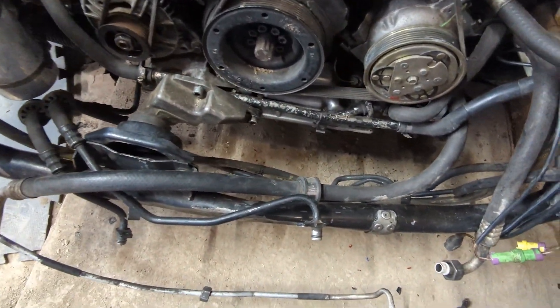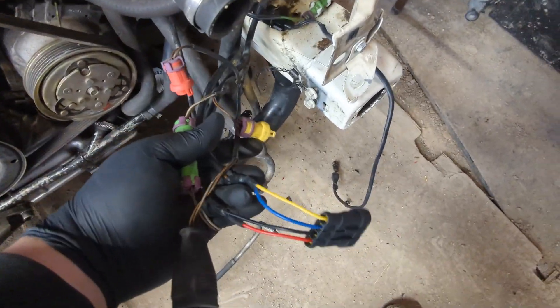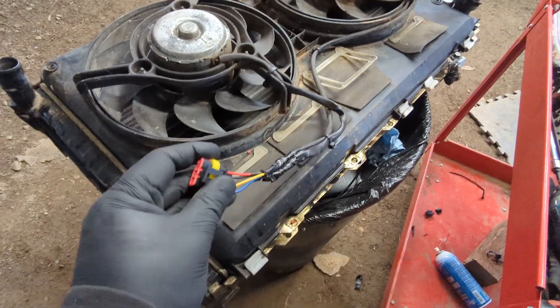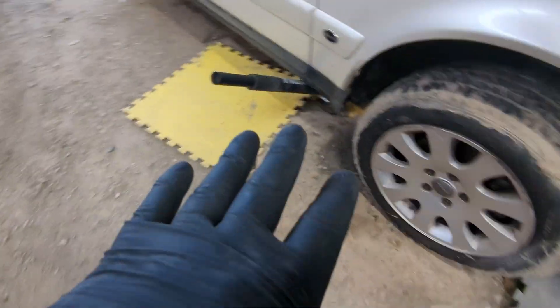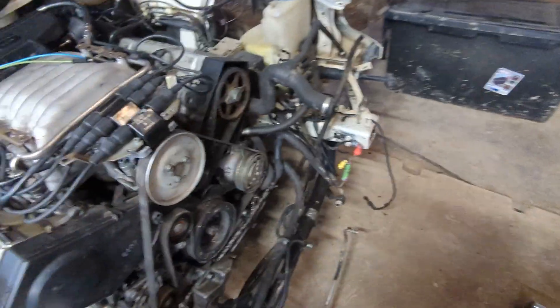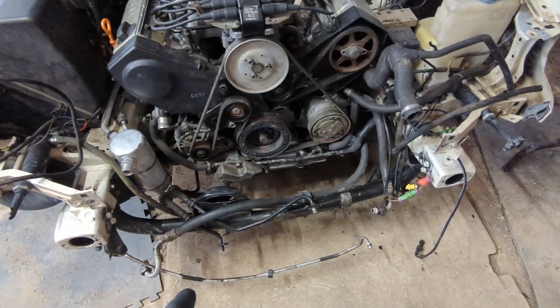I fixed some wiring harnesses. The fan harnesses were busted, so I soldered them up and put on a 410 connector over here as well. Soldered and heat shrink, I just put tape on for extra strength and then fixed that up. Think about everything hooked up. The trans is not currently bolted in — I'm going to wait to see if I can just crank it before I do anything. Coolant's not up, obviously we're not going to run the engine. Some trans fluid might leak out, so I'm going to go get a bucket for that.